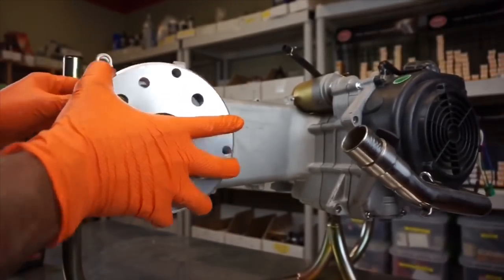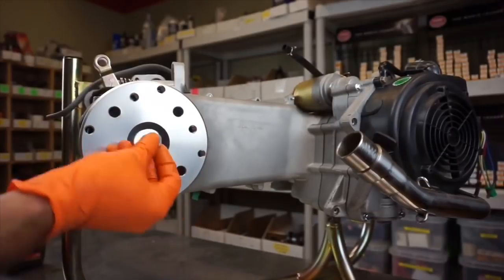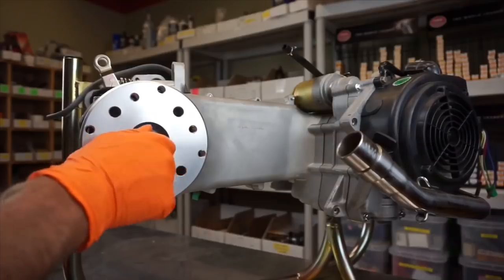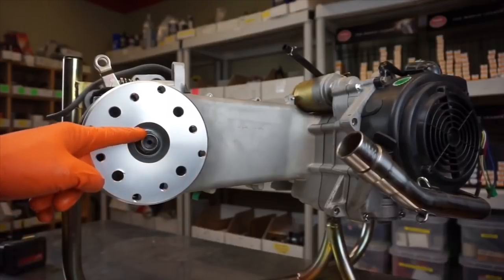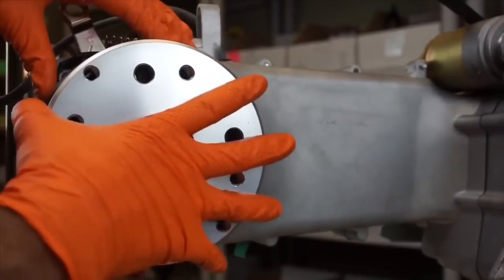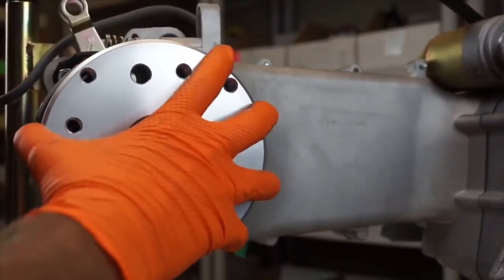Now that you've got your short wheel axle, you've now got your hub — slide that on there. Inside here is your brake drum as well. Make sure that's on there nice and tight. Put the washer on. I like to use red Loctite just a little bit — you don't have to. We're going to torque this to 75 foot pounds — we don't want that to come off. The nut that comes with this is actually a lock nut as well, so that makes it nice. Get it tightened. Now that I got it tightened, check pull back and forth — make sure there's no play whatsoever. There'll be a little play this way and that's just from the gearbox, but that's okay.